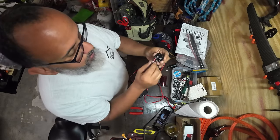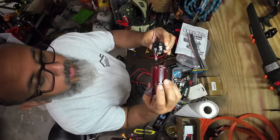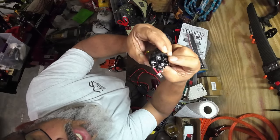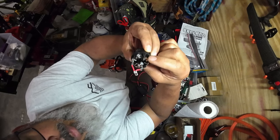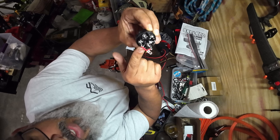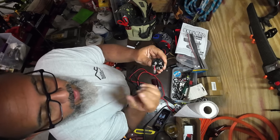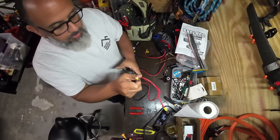This unit has a little nib — standard on all these type of connections. Looking at it from the inside, the one o'clock position is your 12-volt power, which is going to be the red wire. Directly across at seven o'clock is your ground wire, where the black wire is going to be connected. That's all you need to operate this winch — same as coming off your battery, just red and black.